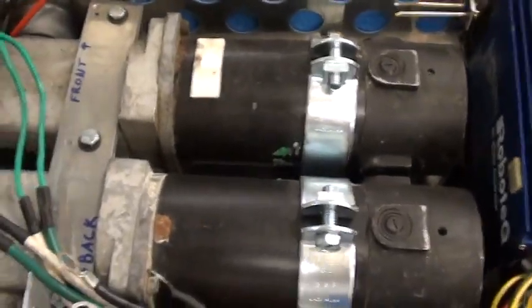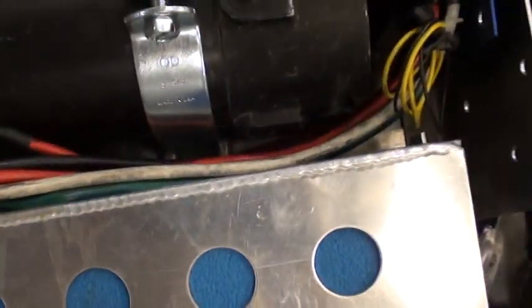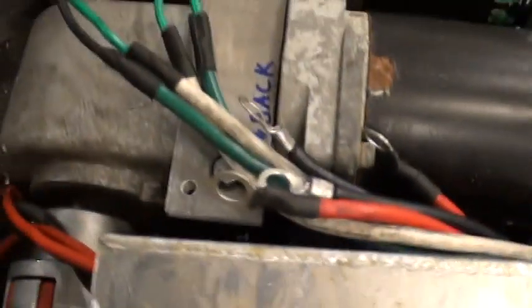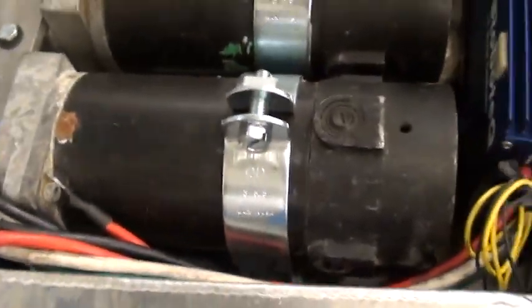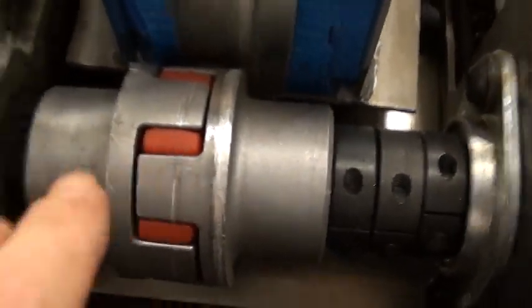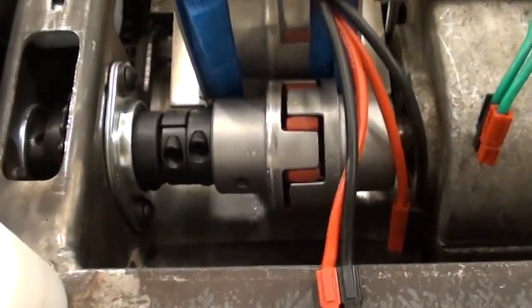The main power plant for the mini-fridge is a pair of surplus wheelchair motors, very similar to the NPC R81 and R82s. The motors are made by Stature Electric — four-pole, 24-volt, about one-and-a-half horsepower each, with a 22-to-one gearbox reduction. These are mounted in a cradle with some foam or rubber, so they've got a little flex. Coming off of that is a Lovejoy flexible coupling — the little red rubbery thing in there gives some compliance so that if the axle shaft gets bent, it's not gonna chew up the gearbox.